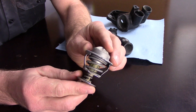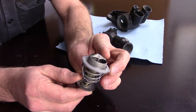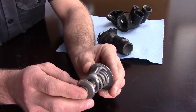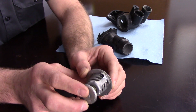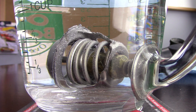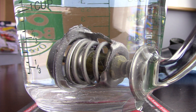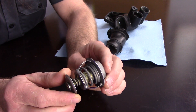Let's start off by talking about what a thermostat is. The thermostat is part of the engine cooling system, and by opening and closing, it can help regulate the temperature of the engine. Not only will it help keep the engine cool when the engine's warm, it can actually help the engine warm up even faster. If the thermostat opens, it allows coolant to flow, cooling off the engine, and when it's closed, it stops coolant flow to heat the engine up faster. It's such a simple part, but holds a lot of responsibility for your engine.